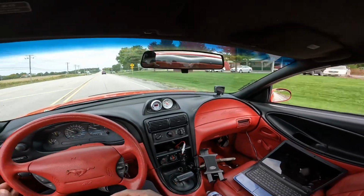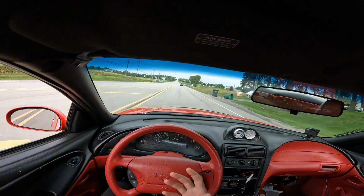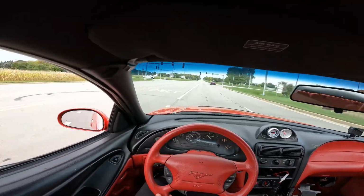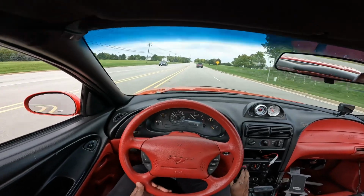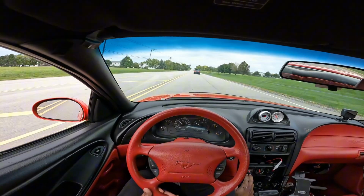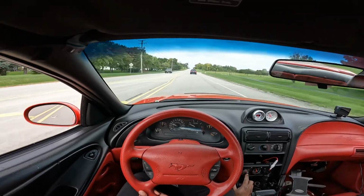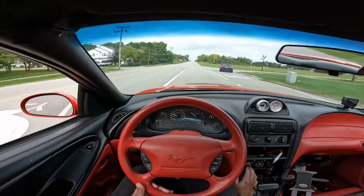Like I say, I'm kind of limited with my mass airflow sensor being at the limit of its range, so I can't get crazy with the boost. So I'm gonna up this spring from 5 to 6. Doing so is going to increase my max boost also.